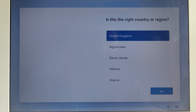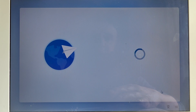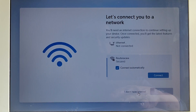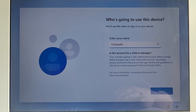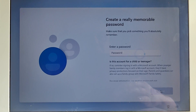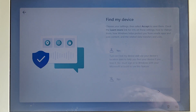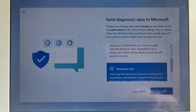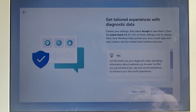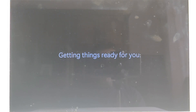The process is almost done. I will set up Windows 11 on this old hardware as quickly as possible. At this point I will select 'I don't have internet' and continue with limited setup. I will enter a name and will not set any passwords. I will select Accept, choose Required Only for privacy settings, and decline the optional options, accepting through each screen. The setup is almost done.